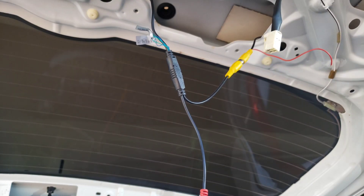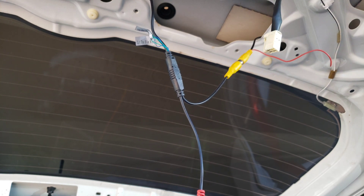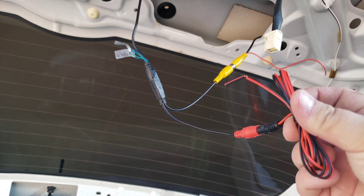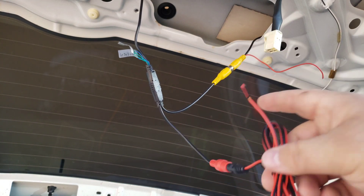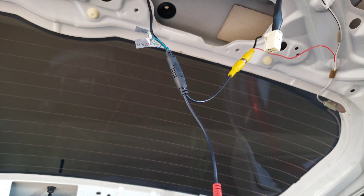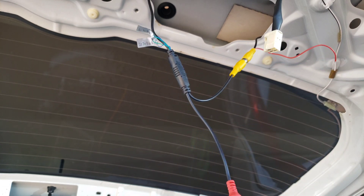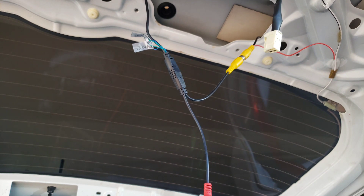The next piece is the green and blue wire that loops. If you don't want the lines that tell you how far or close you are, go ahead and cut the green cable. If you leave it, you'll have the reference lines — which I like, it looks newer and more fresh. Then on here, this is the power and ground you need for the actual camera itself, because the RCA only provides video. You can get this all hooked up to reverse so it activates during reverse. I'm not going to wire this quite yet, but the best thing to do is wire it all the way back so you have as much wire left for the rest of the car to make your wiring as easy as possible.